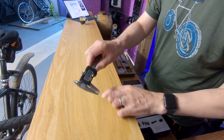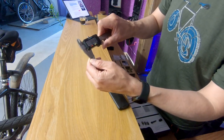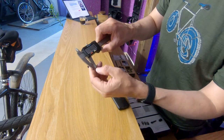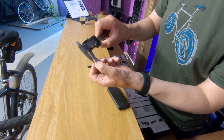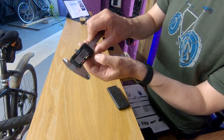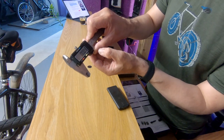These are the vernier calipers I'm going to be using. They're not ideal for the job because I think I have a ridge on my disc, and the ridge will get in the way and give me a false reading. Zero the caliper, move it in and out, move it back again — you should hopefully go back to zero.